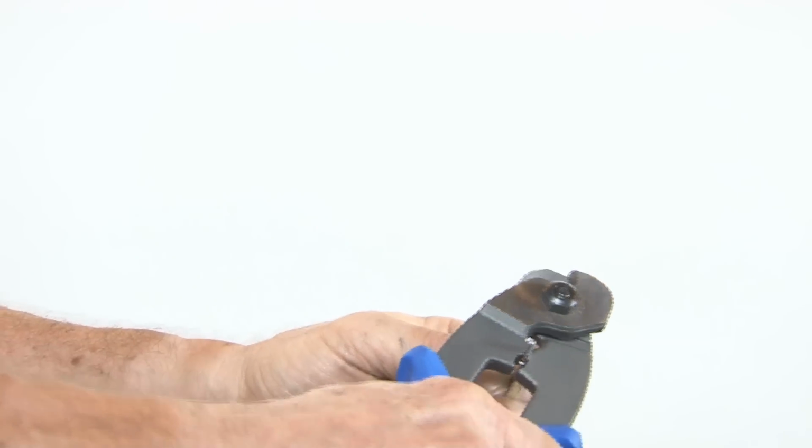The next step is to tune your gears in order to ensure that the cable tension is correct and that your gears are working crisply and reliably. You can just simply refer to our video called Gear Tuning. Now that your cables are replaced, it's time to tape your bars and then go for a ride. But don't forget, you're going to probably have to retune your gears a few times before your new cables finally settle in. So go out and have a great ride.